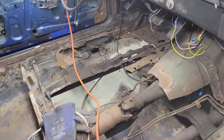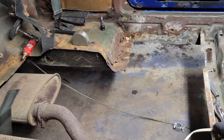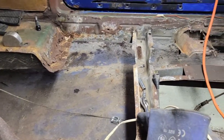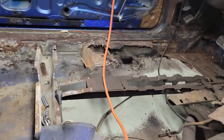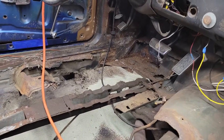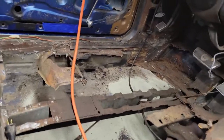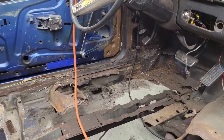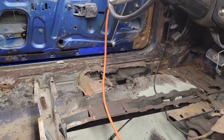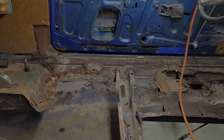Two hours later. All right, it took a lot longer than expected. Obviously, I'm not going to show you all that because no one wants to watch my gas tank empty for 2 hours. But as you can see, I got the fuel lines off the rail. I also removed the line that goes through the wheel well and up to the fuel pump. I've got some cat litter down for a couple spills, and we're going to call it a night, simply because we need to get that gas all cleaned up and the fumes out so we don't catch anything on fire. All right, we'll see you later.